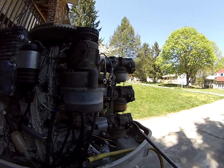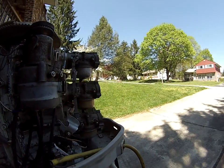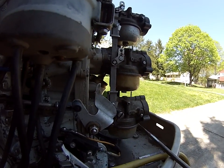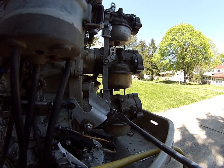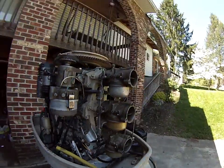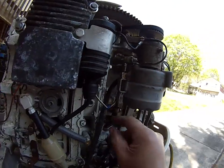Now we take the cam and move it forward until it just touches the roller on the bottom carburetor. You can see that the scribed line on the cam is tangent to the roller on the carburetor. The roller is on an eccentric screw, and by turning this screw we can adjust how far in or out the roller is and how it contacts the cam. This one happens to be set up correctly, and you can see that all three carburetors are fully closed. Now I will clip the ball back on.